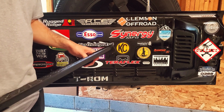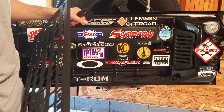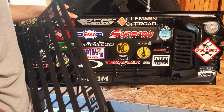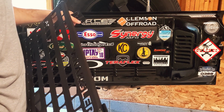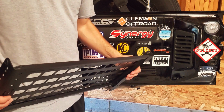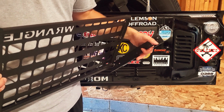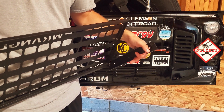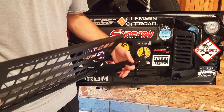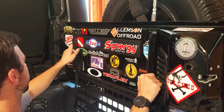We're first going to install the top left corner. That's because this little cutout right here will help us rest the tailgate table on something else, so it gives a little bit of relief when we're installing the other sides. Process for this is pretty simple. Just align it the way you want. Take the center punch and the hammer and mark your spot through the middle of the hole. Then take everything aside, drill your hole, and then we're going to screw it all together.